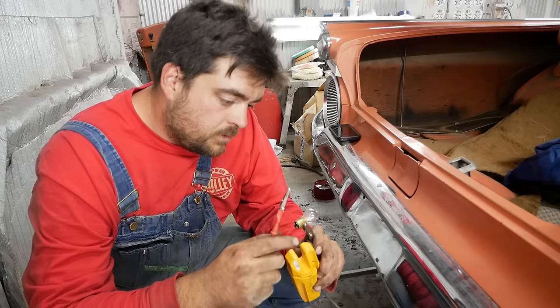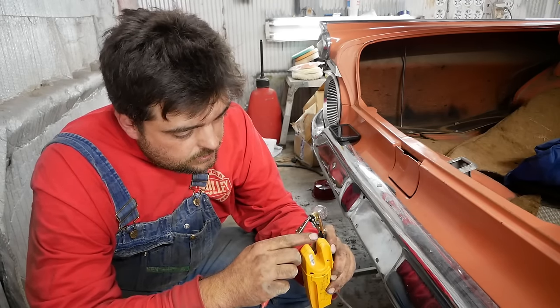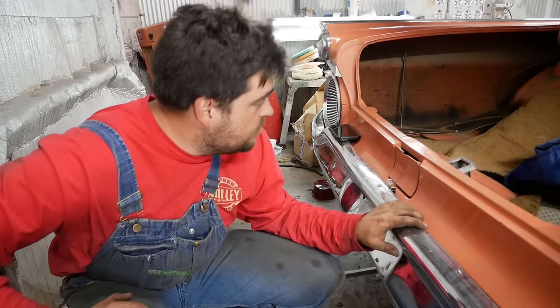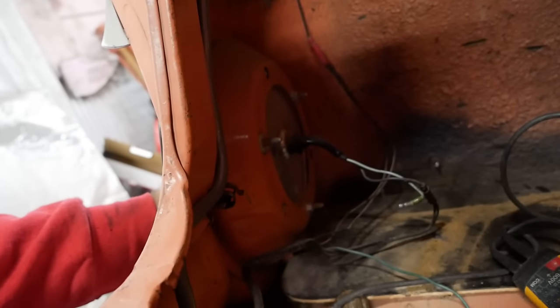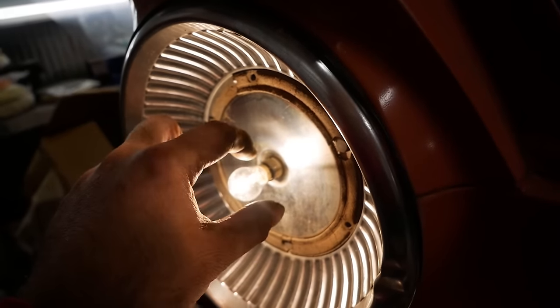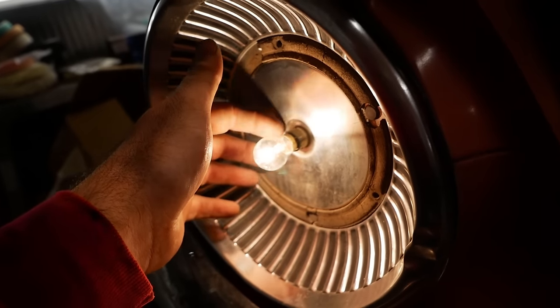We also have no driving lights. Let's check the bulbs — you can do a continuity test, put one meter lead on the body of the bulb and the other on the contact. Both filaments are good, which means we might not have power back here. Maybe it's just a ground issue. I made a jumper to bypass the brake light switch so 12 volts are delivered to the back of the car all the time for diagnostics. We have 12 volts being delivered through the wiring harness to the socket — so our problem is a ground. These ground directly to the body of the car. Just need to clean up the socket and give it a little pinch with pliers.